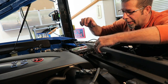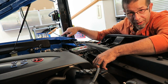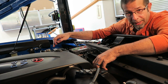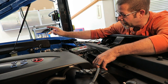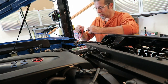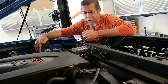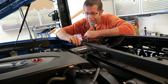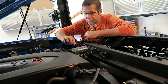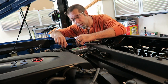Now I just need to run the wires over beside the battery — there are the two I need to plug into. Then make the connection back to the battery, the ground over here. And then put my ignition wire, which is the yellow wire on the unit, into one of these fuse areas, so that this unit will only come on when the truck is actually running, or when the ignition is on anyway. We're going to go ahead and do that next.